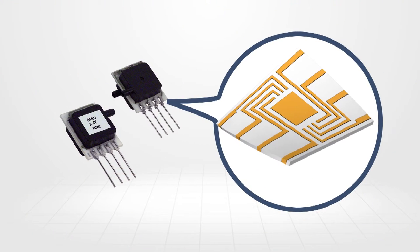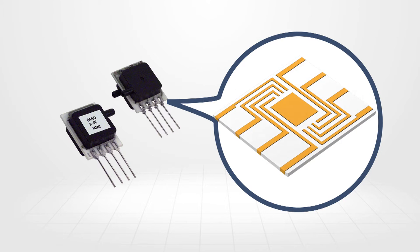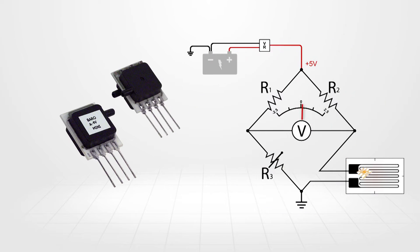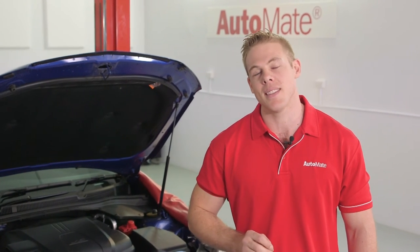The baro sensor uses a strain gauge pressure detection method. A piezo resistive element alters its resistance value as stress is applied. This element is attached to the diaphragm of the pressure sensor. The piezo element uses a Wheatstone bridge and amplifier circuit for a usable signal output. For more information on these devices, please watch our video on piezo resistive sensors.